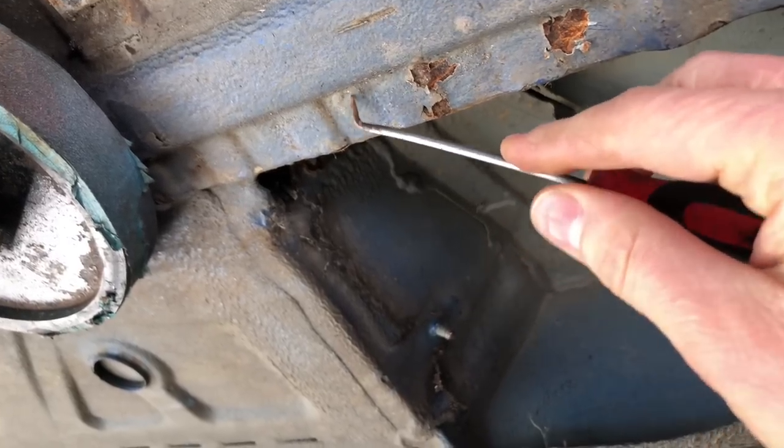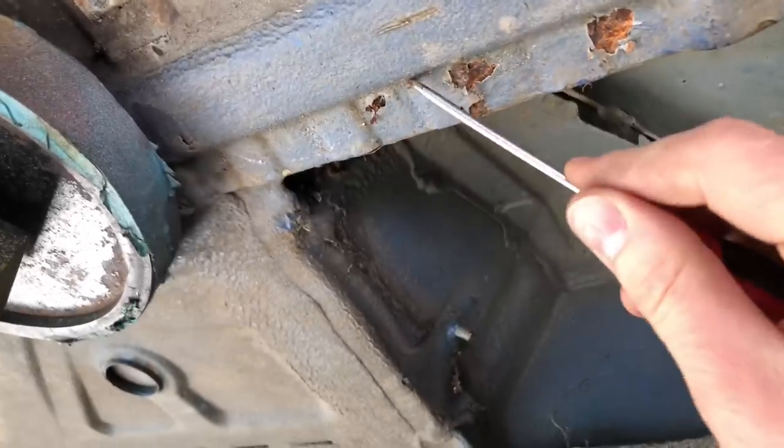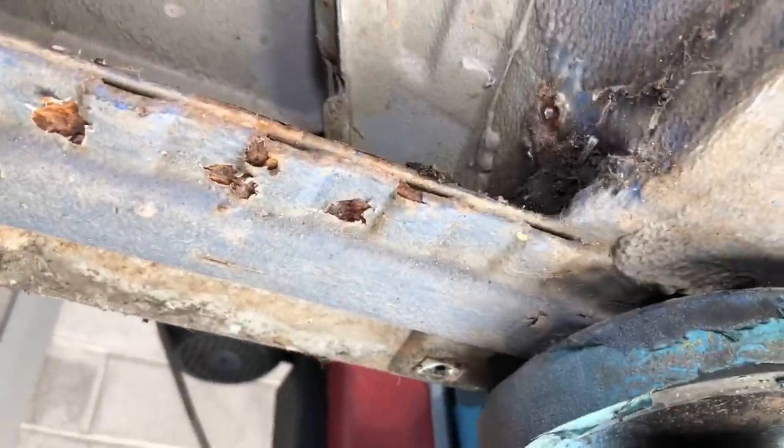What looks like a raised spot there, where the seam sealer wasn't broke at all, is now corrosion. And that's because it's travelling — must be travelling from the seam section up here.